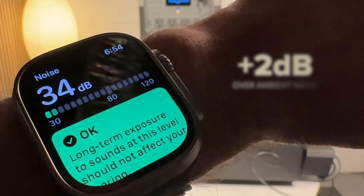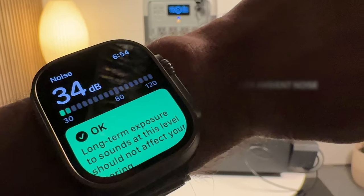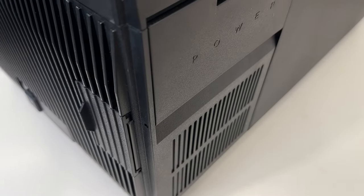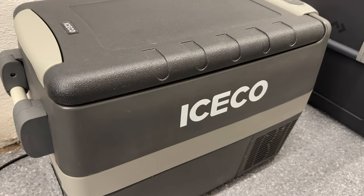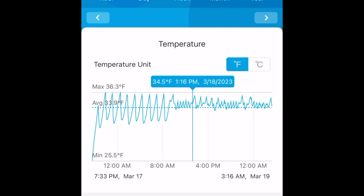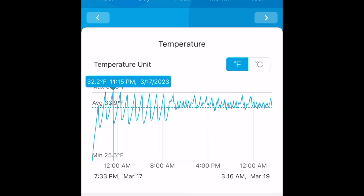The Glacier is whisper quiet and the fans make a very pleasant whirring sound, so it shouldn't bother anyone in a camp setup where you're sleeping nearby. Compared to my ICECO, both are similar in loudness but I prefer the sound of the Glacier. In standard mode it runs the compressor pretty much non-stop, keeping the temperature within plus or minus one degree, which is very impressive. In eco mode the compressor cycles less frequently and the temperature varies by about plus or minus two to three degrees Fahrenheit.